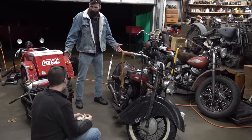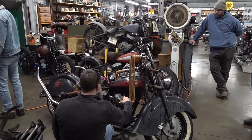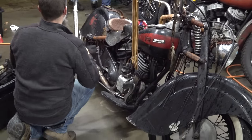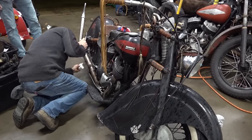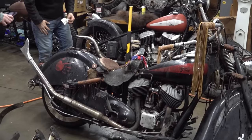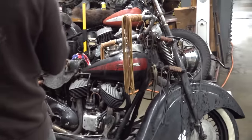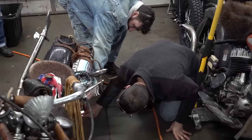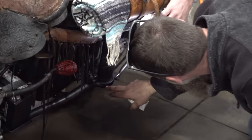The frame number's over here. It sure looks like a '48 frame. Down over here you can see it says 348 - it's a '48 frame. So the expert was wrong. It is a '48 frame. What you're looking at is a number right down there, and it says three - three means Chief, 48 is the year, and this is your production number. So that's 348-318.